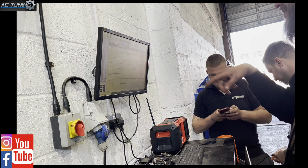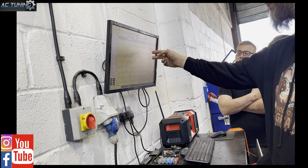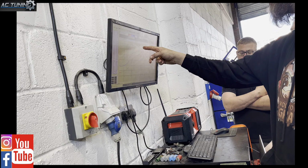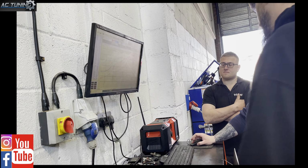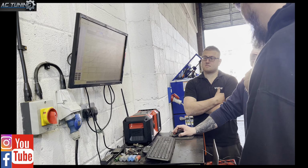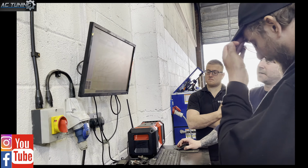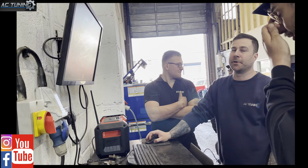And that's literally what I was saying. That is probably your difference between standalone and aftermarket. Because the thing is, they'll pull timing out and they'll richen it up. Yeah. And there's not really much you can do. Yeah. It's just what it does. And that's the thing, if you went aftermarket with it, you would kind of get the timing back in up top.